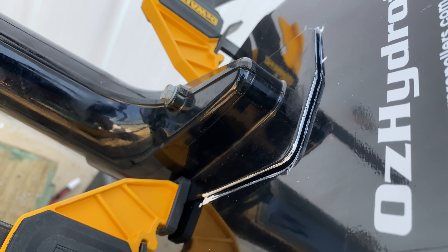The bottom actually doesn't look too bad — turned out pretty schmick. I just smoothed it down like that. I'm not going to spend my whole afternoon messing around with it but I think it looks pretty good. Now I'm just going to grease this shaft and put the propeller back on. All right, we're out on the Hobie getting along — we're going to test out the motor. Wind noise is pretty bad here so I'm just going to voice it over. We're going to quickly film the sail and give the motor a bash. Before it was really cavitating when I took the turns — let's see how it goes.